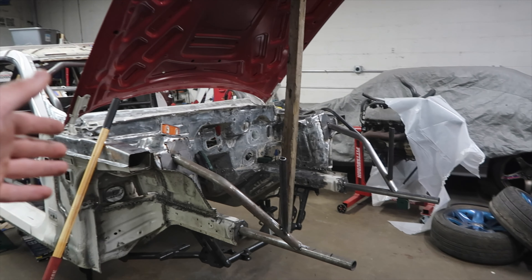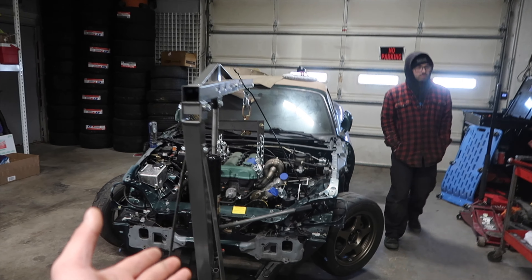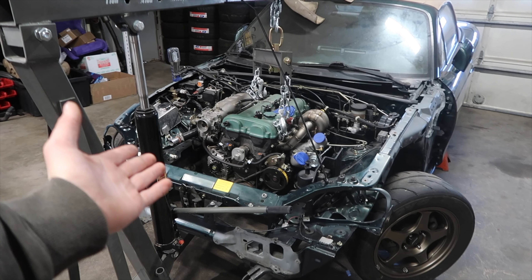We got a lot more work to do but we are a whole hell of a lot farther than we were in the last video. I started working on the rear rad a little bit more - I got a piece of sheet metal cut out and then Howie got here and we just started tackling the front end. We're gonna finish that up some more today. We picked up some hood pins, we got to make some more plates and weld in more bars. Everything's just tacked right now but we'll weld everything fully in by the end of the day or tomorrow.